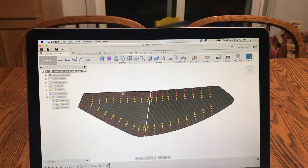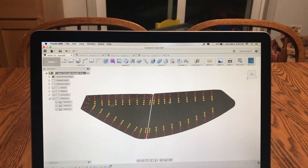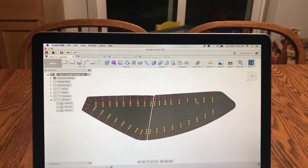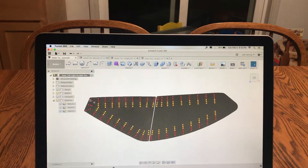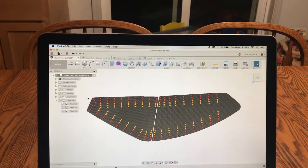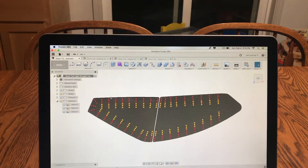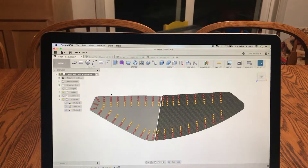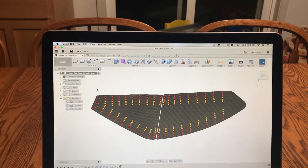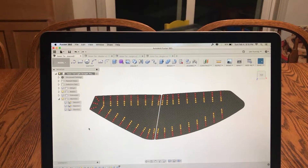Finally I came up with this — this should be the end result I'm looking for. This is the inner tail light and this is the outer tail light, and it'll chase from this side out this way. I have to use three because three makes a really good pairing — all of these will be threes for the LEDs. You want to use three LEDs with a resistor to give you the brightest possible result. Once you start adding four or five it starts to get dimmer, you have to use different resistors and it's not going to be uniform.